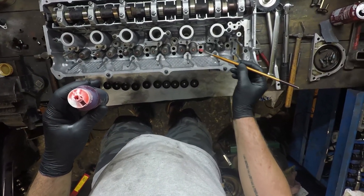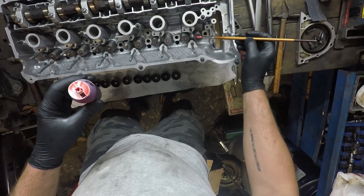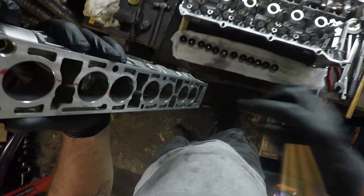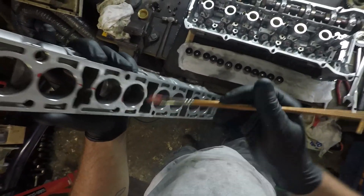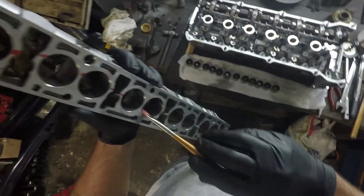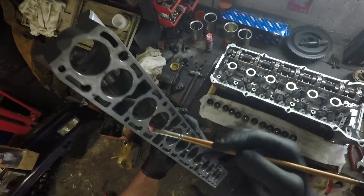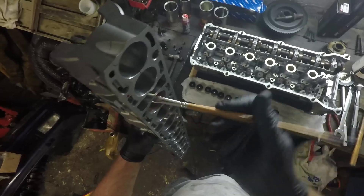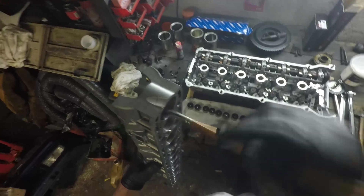I'm using a little paintbrush to apply the lube — probably the easiest way to get it down in there and control it without massive gloops running down on top of the springs. Similarly, I'm using the same paintbrush to brush just a smearing inside each one of the cam lifter holes. I'm using the Permatex assembly lube that came with the copper spray gasket — it's pretty much the same as Torco assembly lube, bright red in color so you know where you've put it. Nice and thick and gloopy, and it gets on all the bits you want.